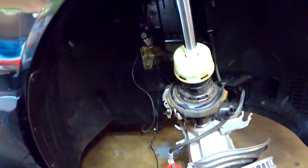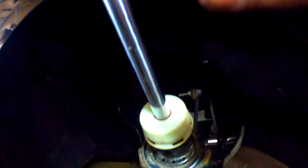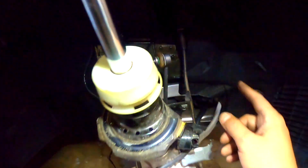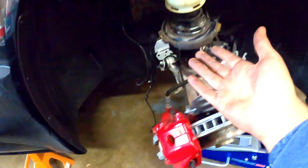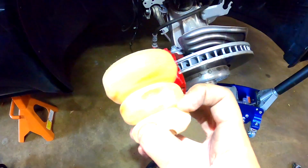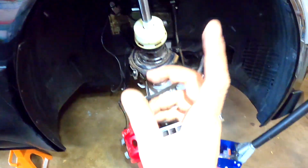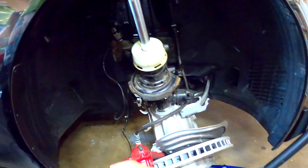Wow. Every time I do something I learn new things and mistakes. Before you remove the lug nut for the strut, remove this end link. If not, it's gonna be a pain to remove that. Okay, and the next thing I have to do, remove this plastic. This is like a metal piece on the top of the strut, and this bump stop I have to cut. Only one circle, I have to cut it and put the new ones. We're almost there. This is the first one, but I'm learning. Okay, so let's put the new spring.